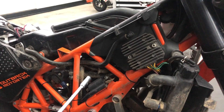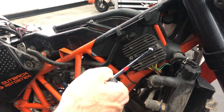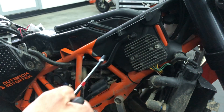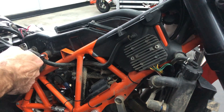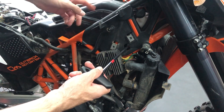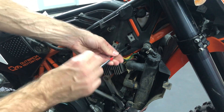From the right side of the motorbike, here is the radiator. So first you have to remove the radiator and then you can access the bolt holding the airbox. The one in the back is pretty easily accessible. You see here is the hole and there below is a bolt holding the airbox, so you need to access it with a longer tool and get it out.